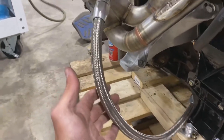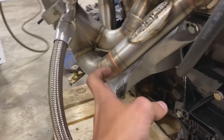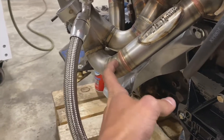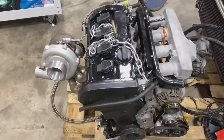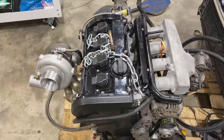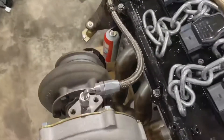The return looks weird — I'm not crazy about it. But if it went straight down it would practically rub against one of the hottest parts of the engine bay, so I don't want to do that. It's going to come out 45 degrees and then go into the pan. When you're standing in the bay I don't think you'll really be able to see it anyway. The feed looks awesome though.